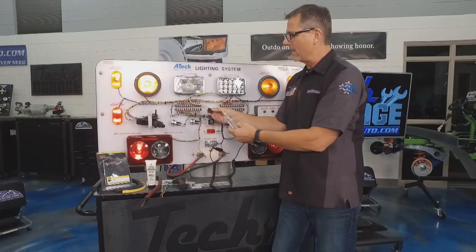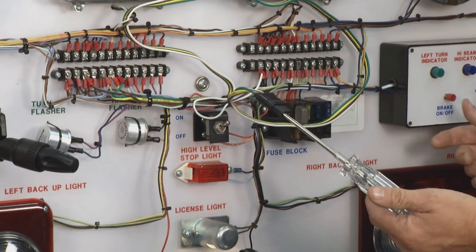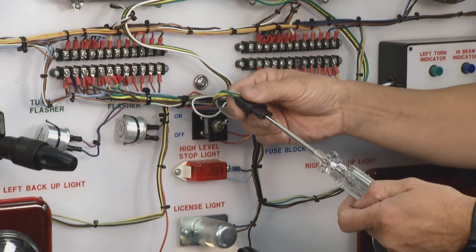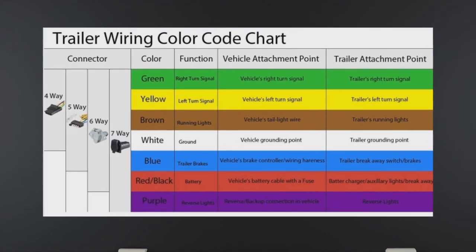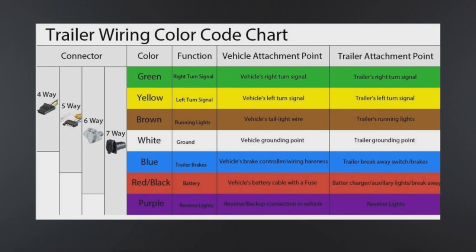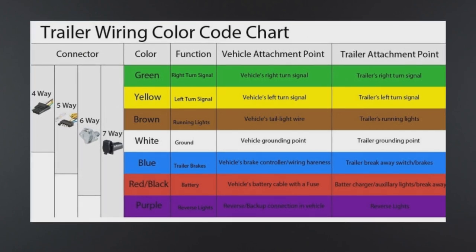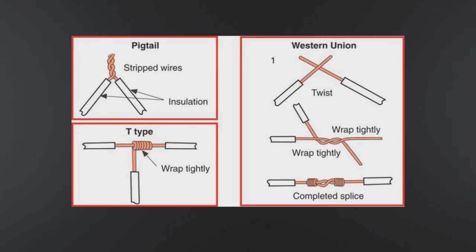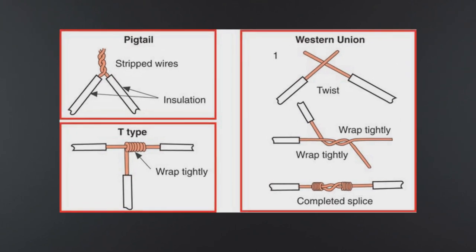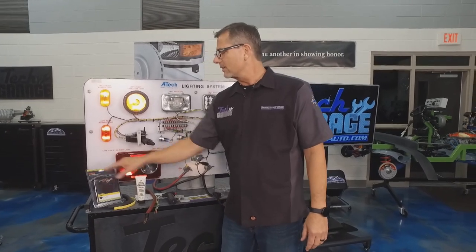Constant power. Your white wire is a ground wire. And your brake lights — they're tied into both left and right side wire harnesses. So if I hit the brake switch, you can see it lights up. Perhaps you have a six or seven-pin connector — the blue one is your trailer control. You could have a red or black that ties into the vehicle's battery, a fused one. And the purple is usually reverse. When you're making wire connections, always do it right — use the wire loom, or just go to rockauto.com and get a whole connector. Plug it into the T and you'll be good to go.